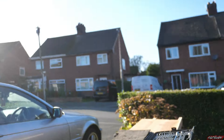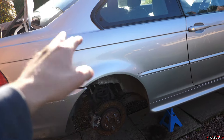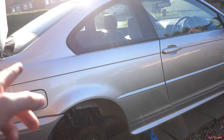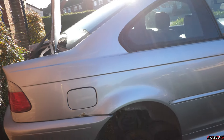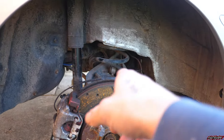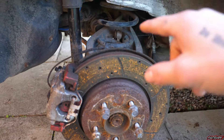I'm going to pull that out, polybush everything, weld the diff up, and pretty much check everything over. Hopefully find some better condition trailing arms to chuck in, with either better bearings or new bearings if I have to. They're pretty rusty so I'm not too keen on reusing them. I'm still waiting on my Amazon order - I ordered some half-inch torque bits for the drive shafts because my little socket set didn't have them. That order is literally supposed to be here any minute, so I'm going to go through and get the calipers loose, unplug all the wiring for the ABS, wheel speed sensors, brake pad level sensors and stuff like that.